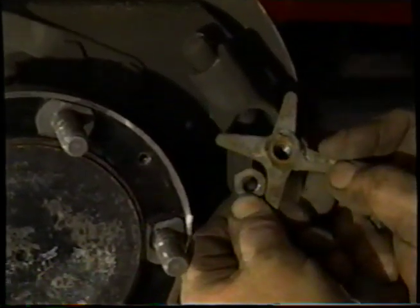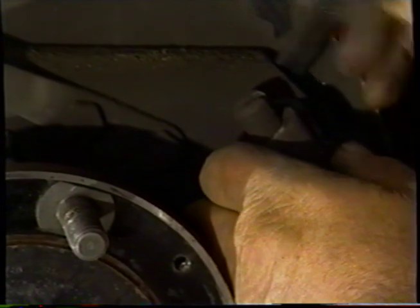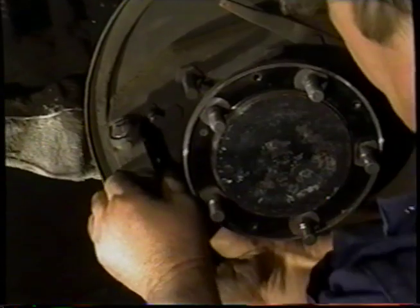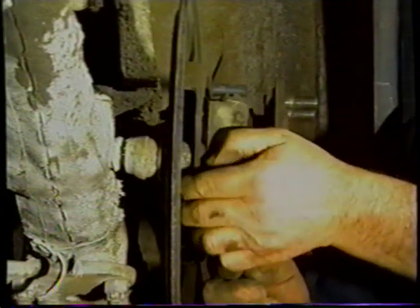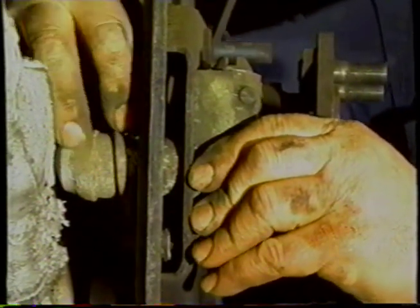There's the lock nut and the handle. So we'll go back to our bolts again. So keep the thing coming towards you. We'll pull that out. And that's the backing plate. Now we're going to pull the expander out. Couple of factory washers on the back. Also, we've got a rubber O-ring stopping us pulling the expander right out. And there's the dust cover. I'm going to work the dust cover through.